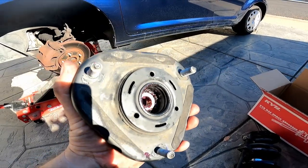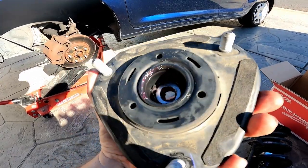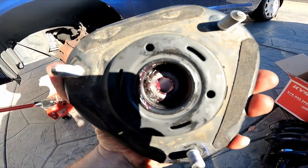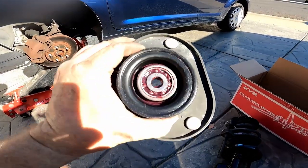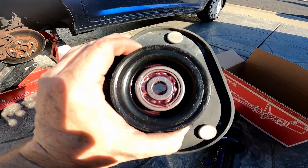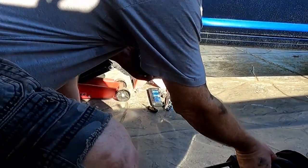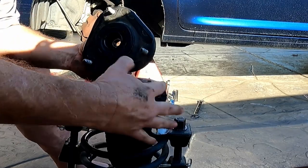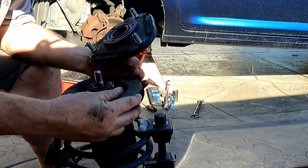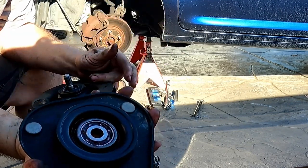You can kind of see where I greased the bearing — the red grease is now pushing the black grease out of the bearing, which means I've got it pretty well packed. You can't see through anymore like you could before — that bearing was pretty dry and now it's very wet. So now we take the spring and the shock assembly, make sure this washer is centered over it. This is the washer that seals the bearing on the bottom side.